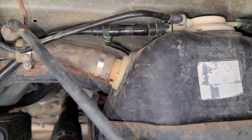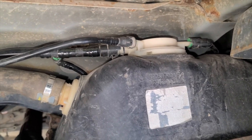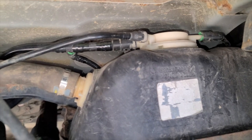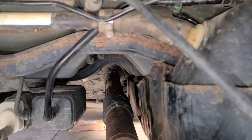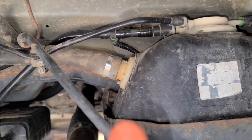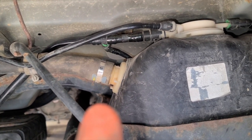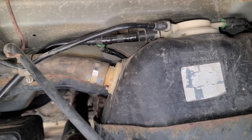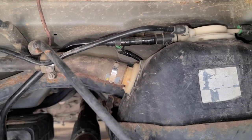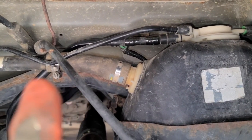All right, tank's back in. These are what the connectors should look like. This guy right here was our broken EVAP connector. Canister connection's okay. Remember, as you're lifting the tank, to connect the fuel filler line before you get it all the way in place. Remember what a pain in the butt it was to take that off. Need to tighten those back down. Again, those are 7mm or flathead screwdriver, right?